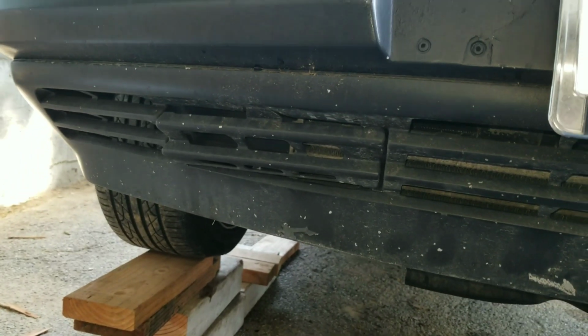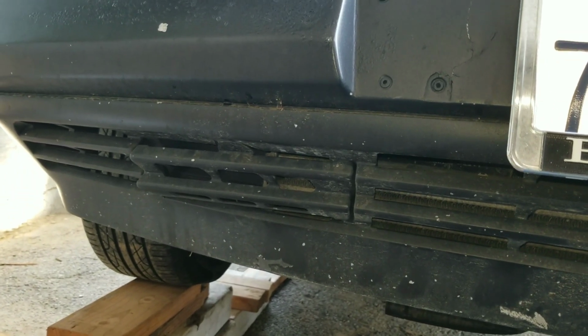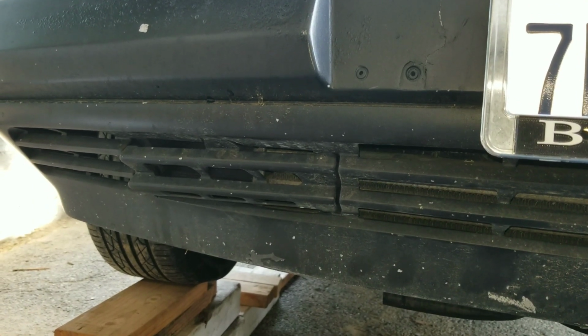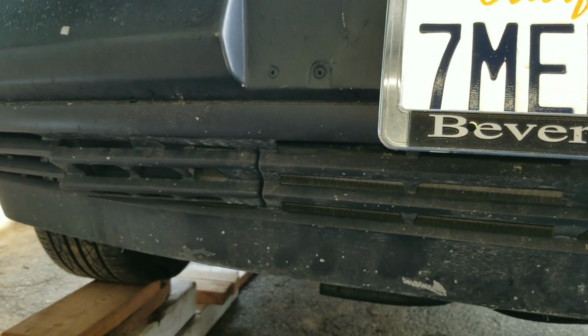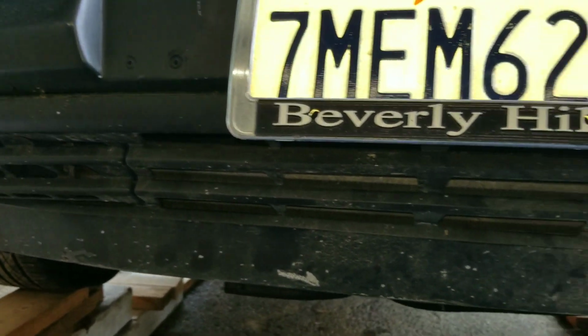And get into like airplanes here where we're talking about cooling drag and that kind of thing. And so who thinks about cooling drag? Well, electric car guys actually, in particular Tesla, have thought a lot about it because they're trying to eke every bit of mileage they can. In fact, the new Tesla Model 3 I don't even think has a battery cooling heat exchanger on the front of the car. It has only, I believe, the AC system with heat exchangers on the AC system cooling loop going into the battery cooler.